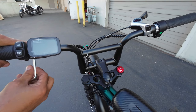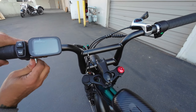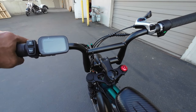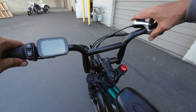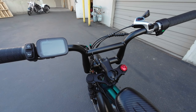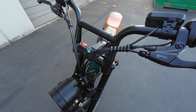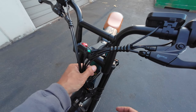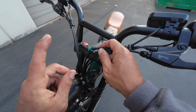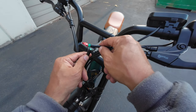Next, we're going to tighten up everything on the handlebars — this is a really crucial step. You want to sit on the bike in the riding position you'll assume when you ride, and line everything up so you feel comfortable. Make sure your brake levers are even before you tighten them down, the shifter's tight and positioned the way you like it. The display is already in place. Make sure all the connectors near the handlebars are connected — here's the display connector. If you don't have enough slack, loosen the display and slide it toward the center of the bike.